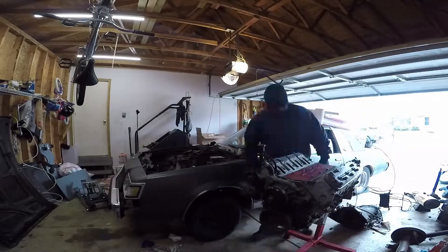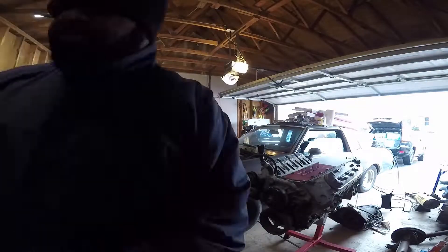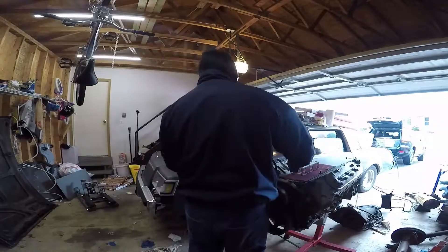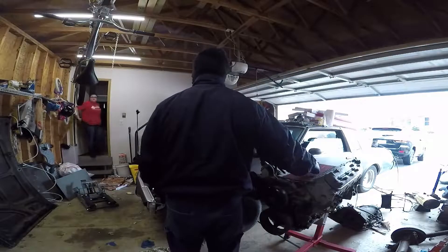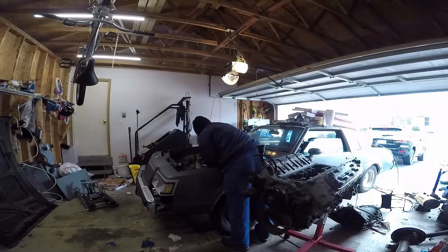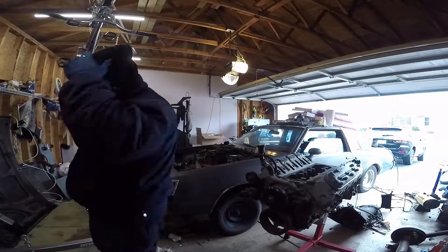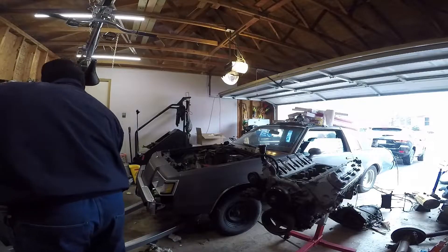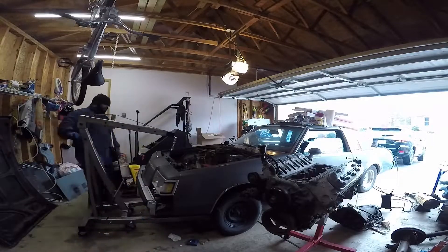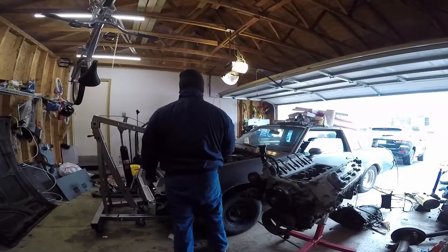What's up YouTube, this is just an update video. I had told a lot of you guys on Facebook that I was gonna come through with a new video, and this is kind of like a time-lapse of what I did over the weekend. I ended up getting a lot done on Sunday. As you can see, I'm taking off the lift plate off the engine I've been working on — it's just a 5.3 that came out of an Envoy, and I'm gonna put it in the Regal. I had my other 5.3 that was out of a Silverado, but it ended up getting a little wet last year. The cylinder wall got a little rusty, so I'll probably use it later after I get it cleaned up, but right now I was just using it for test fitting.